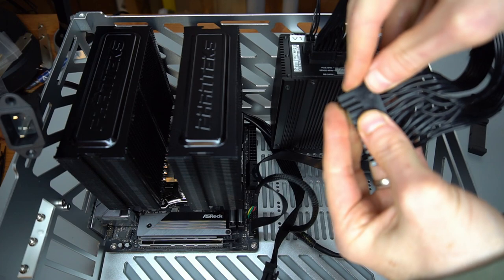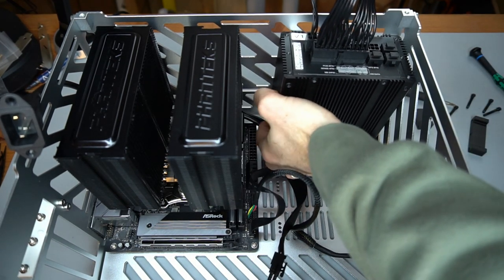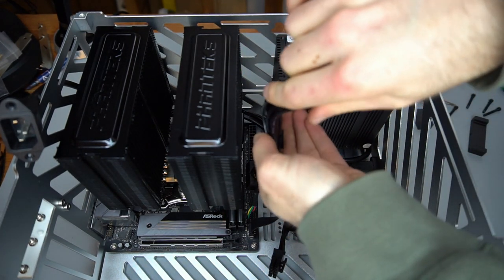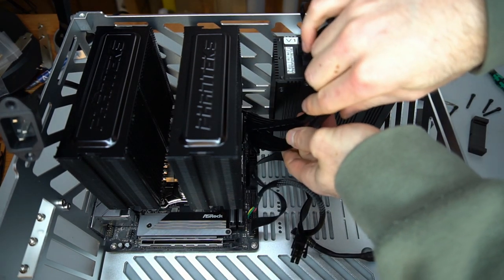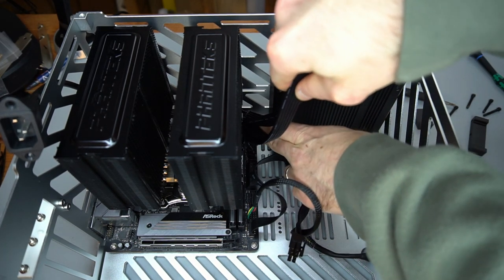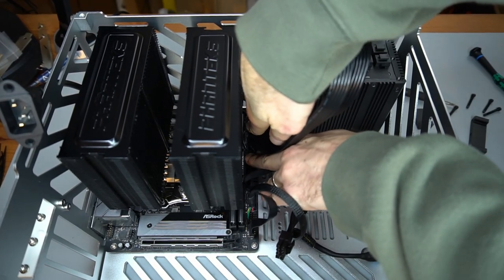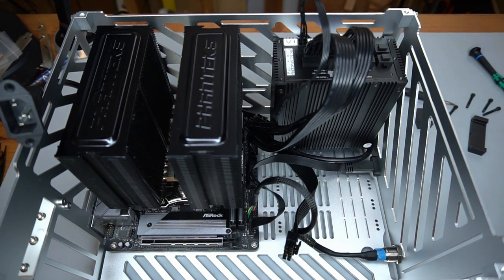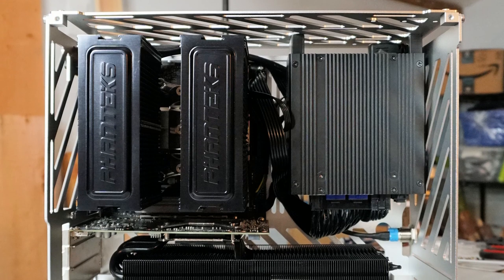I'm not used to working with such small tower-style cases, and I have a newfound appreciation for them. Installation of the power supply was a bit tricky. One, because the AC pass-through cable interfered with the PSU mounting brackets, and two, there really is not much space to easily route the ATX power cables from the power supply to the components that need them. The 3D printed power supply mounting bracket was easy enough to cut, so the pass-through cable issue was not a major one. I'm really happy with the result and think the case is beautiful in its simplicity.